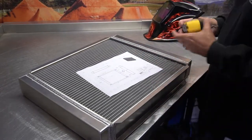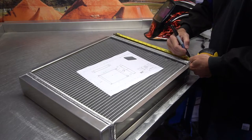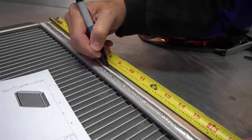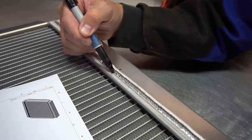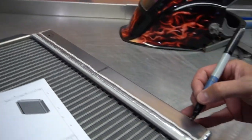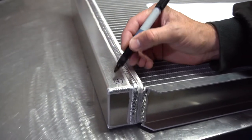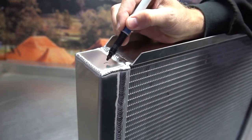Step one: we're going to do the baffle. We're going to put it halfway through the tank. This particular radiator is just over 17 inches, so we're going to go somewhere in this area. When you place your baffle, put it between two tubes — we're going to go right down the middle of that fin right there. We're going to mark the center for our upper hose, mark the hole for the outlet going over to the other side, put a drain cock right about there, and put the filler neck in the middle of this tank, keeping it forward a little bit.